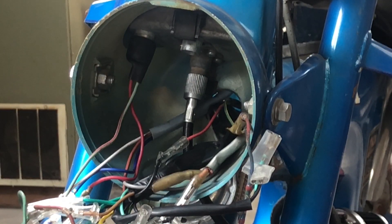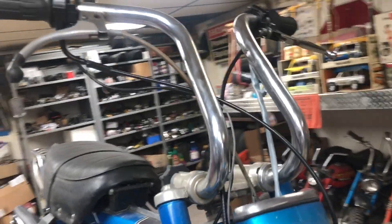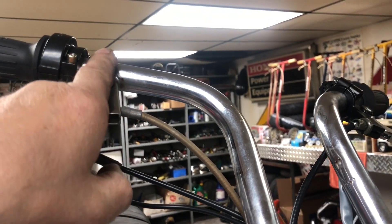I'm not going to put everything back together yet. We've got gray cables and black cables — I'm going to take the wiring back out, take the horn button wiring and front brake cable off, and spray paint the housings black so that we have one color cable. I also need to change this long throttle cable out for a shorter black one.